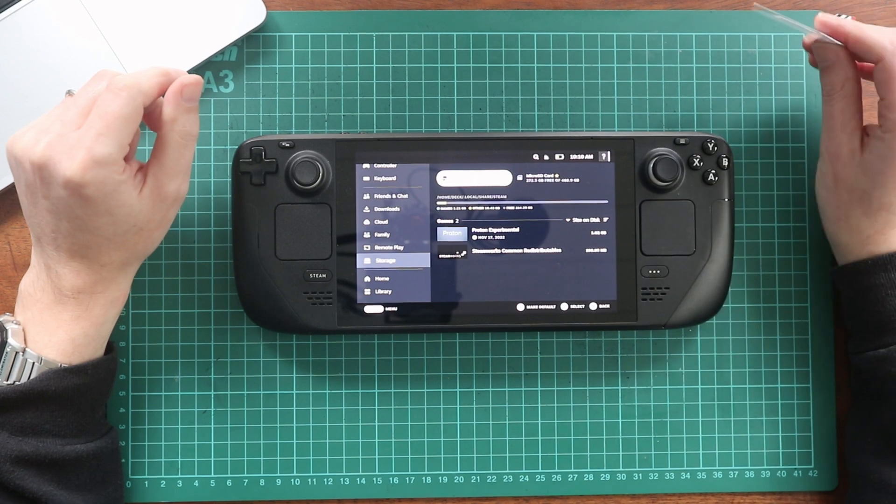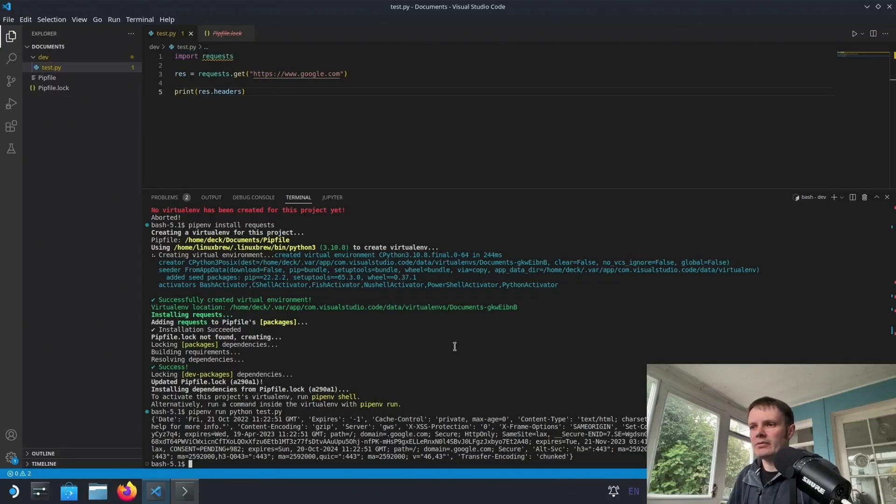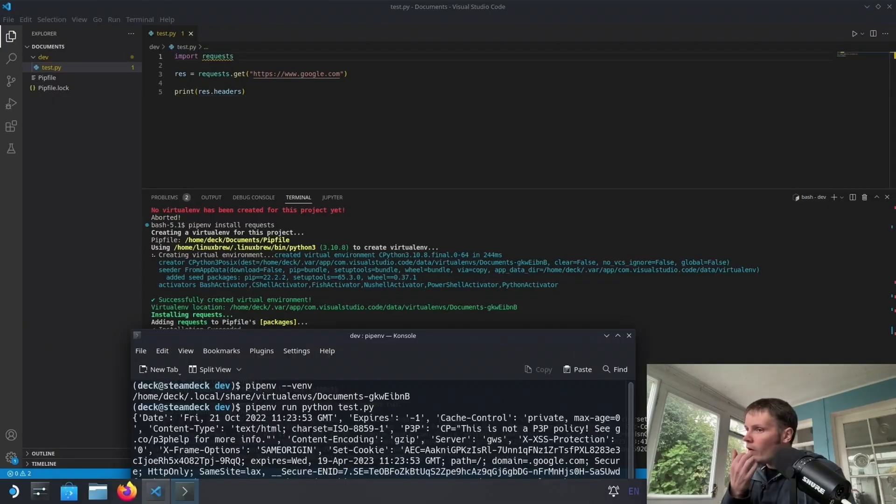So what have we learned here? You should not use random bits of plastic for prying open your Steam Deck — use an official spudger or toolkit. The ribbon cable inside is very flimsy, and you're better off using a spudger tool to get that power cable out rather than pulling on the tab. And you need a decent Wi-Fi connection to download and reinstall SteamOS. I hope you found the video useful. If you did, give it a like and consider subscribing. I've also done a video on coding on the Steam Deck where I try to install Python and use it for programming — be sure to check that one out. See you soon!